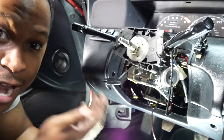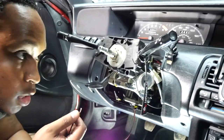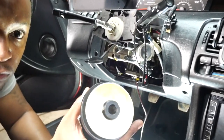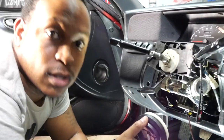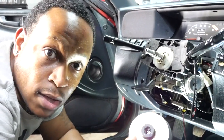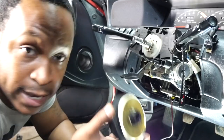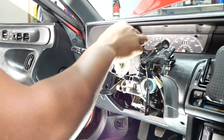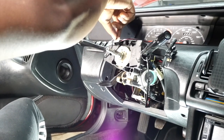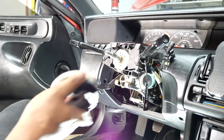I already tested this — hook the battery back up. Number one is the horn for the Honda Prelude 92 to 96; your car will vary. To hook up the horn, there's something called a shoehorn — I will link that in the description. What it needs to do is contact the back of your short hub. Or you could take a feeler gauge or a paperclip and literally just hook the wire up and make sure it stays in contact with the back of the hub, because the horn connection works by allowing current to flow through that contact point. I already tested it with the steering wheel and it works.